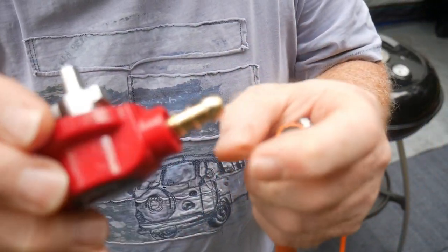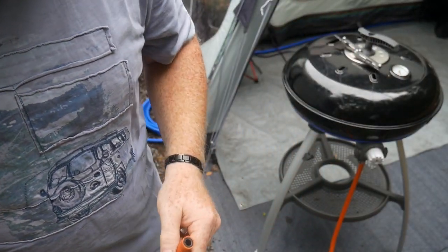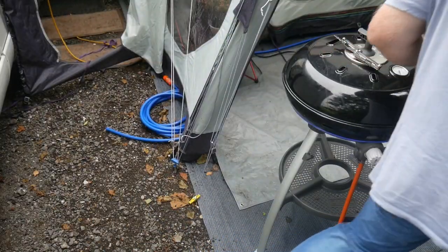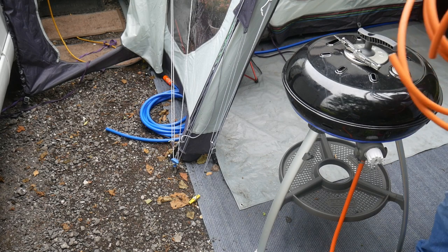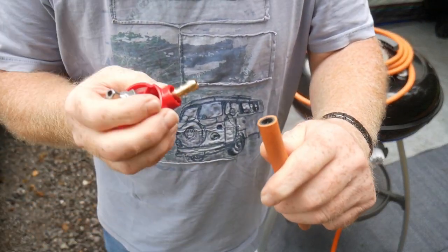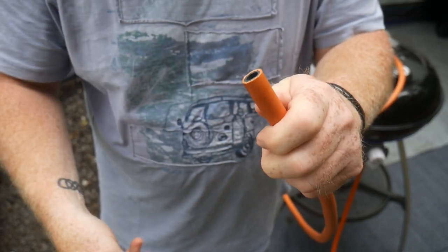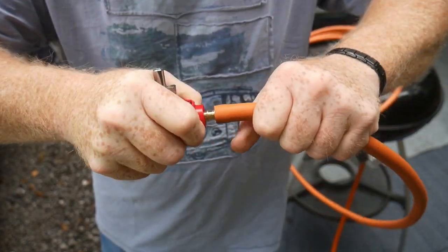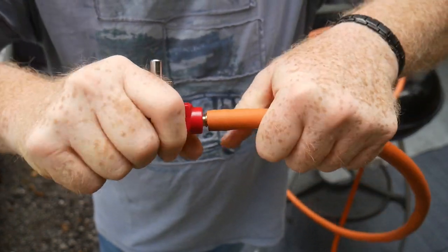See, it's a pretty tight fit onto there, so I'll just take that Jubilee clip off, get the new hose. This is the new hose here, and you'll see that just pops in there. I'm going to put the Jubilee clip on first, and then that's a nice sort of easy push on fit on there,